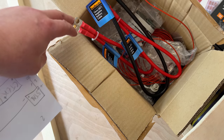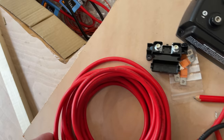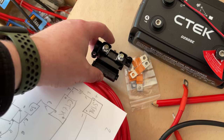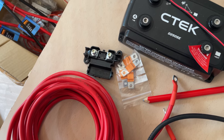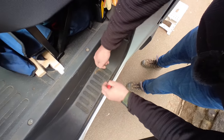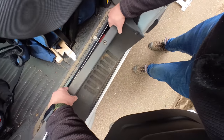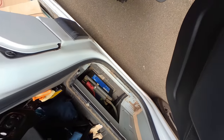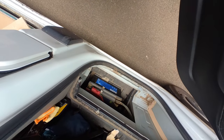I've bought a couple of extra cables from Halfords, and I did buy a kit that comes with 30 amp fuses, but I'm going to be fitting some 30 amp breakers instead. The first thing I've got to do is check to see if I've got a smart alternator fitted, because that needs a little bit of extra wiring for the CTEK. The battery is located under the passenger side footwell in the Movano.